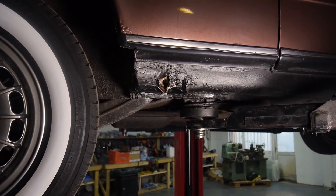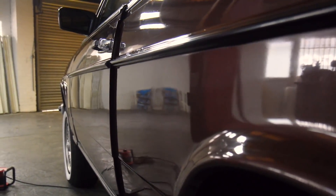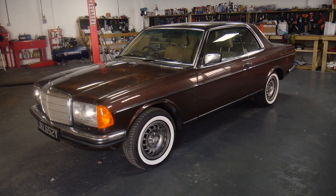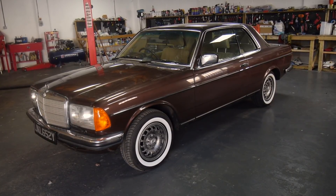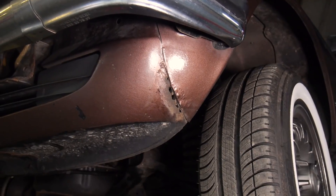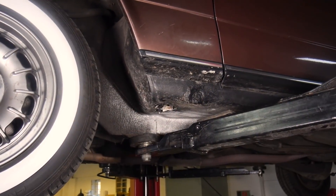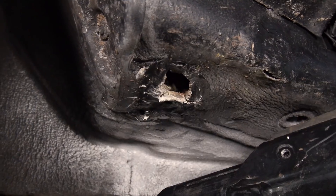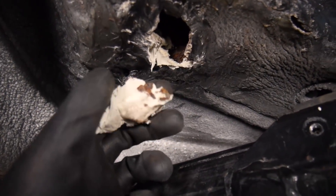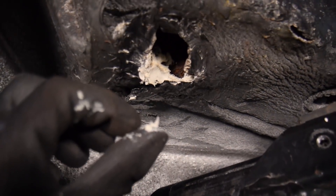So there's quite a lot of work to look forward to — a good amount of bodywork with bits like this and a few larger dents that we'll get to during the series, as well as the full respray and re-chroming of the trim. Quite early on in the series we'll find out just how easy or difficult it is to remove this chrome trim, because it needs to be professionally replated by a company that will probably have a waiting list, so it's good to get it off, measured and booked in as soon as possible. There are one or two other spots that need attention — a seam has started to rust and has spread to both pieces of metal. On the front left of the chassis I found some fresh, still not hardened sealant — the type you'd find in a bathroom or kitchen. It would seem as if whoever did this opted for less expanding foam on this side, so even the half job was half done. This is the definition of a bodge job, so it will be nice to put right what was done wrong.